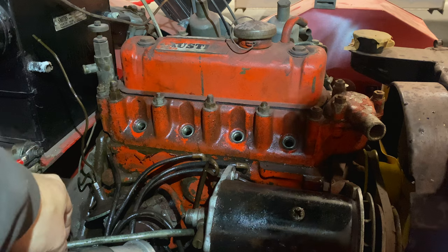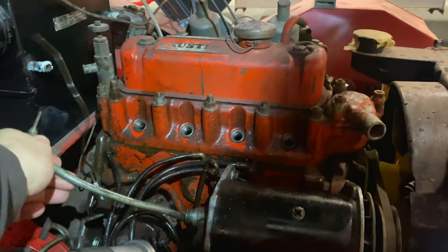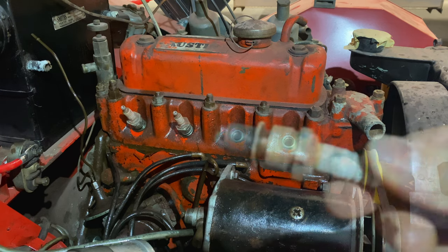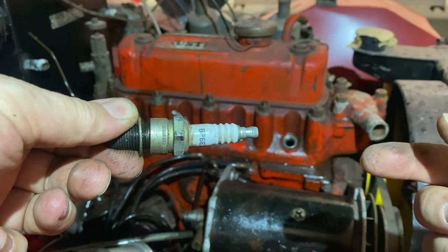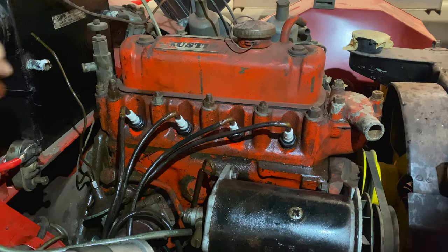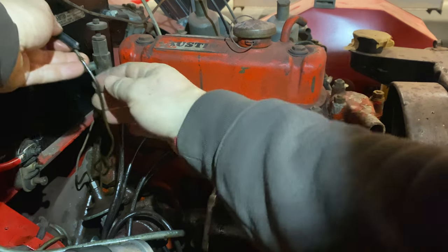Next thing to do is take it out of gear and see if the starter will turn it. The car is in neutral — this is my power wire running to the starter. Let's see if the starter can turn the engine now. Okay, that's a good sign. Now that the engine turns over I can put the spark plugs back in. This spark plug — the top is spinning, so this one's probably not any good. I'm going to go find another set of plugs and throw in a set of new ones. If the engine starts I'll need to plug this oil line; I don't have a gauge hooked up right now, so I'll use a hose with a screw on the end to plug that up.